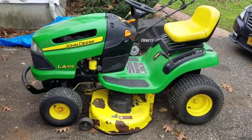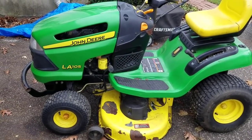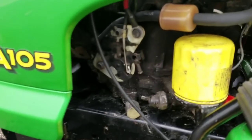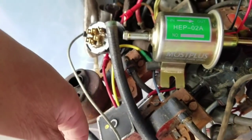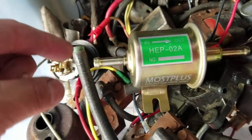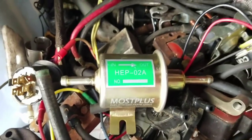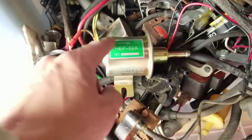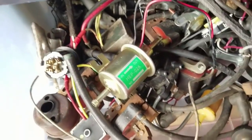The electric pump pumped too much gas, and the black plastic one didn't get enough gas. This engine was designed for gravity fed. I did get it to run by using a shutoff valve turned halfway, so not as much fuel was getting through — that controlled the gas and worked pretty well. However, because it impeded the flow, this thing was working extra hard to suck fuel and it burned out. So I said to hell with that.